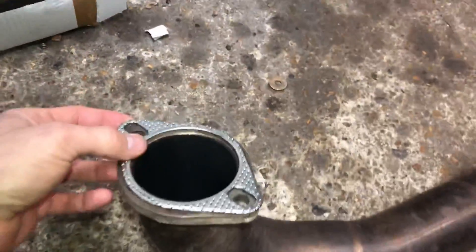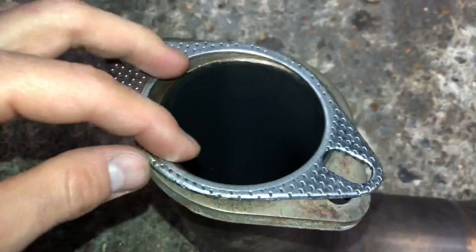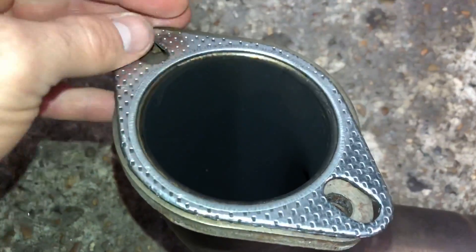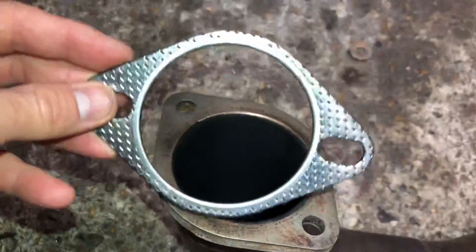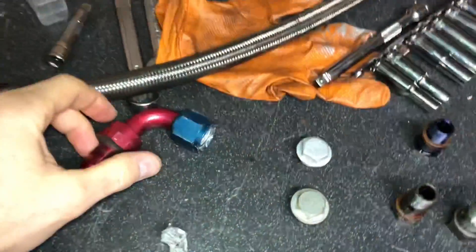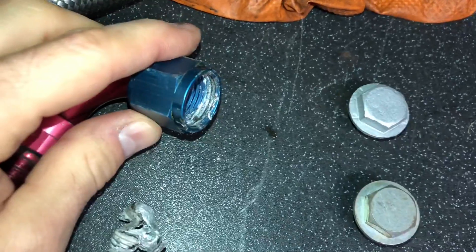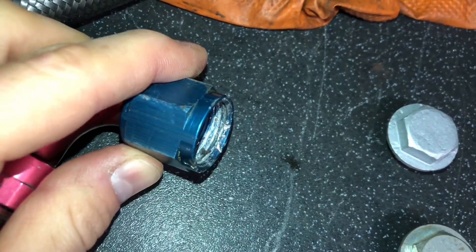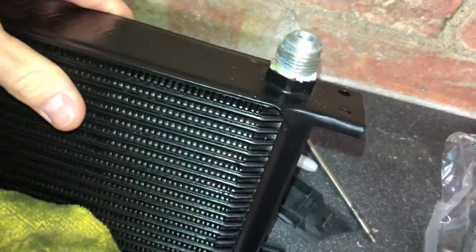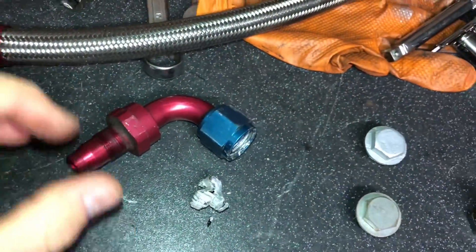Just about to fit the downpipe. As I've mentioned in previous episodes, I like to use fire ring gaskets for these — they fit absolutely perfectly. There's a ring around the inside of the gasket that keeps the exhaust gases in; the cheaper ones don't have that, so make sure you use them. This downpipe didn't have one and was blowing badly. Still having issues with the oil cooler fitting — managed to get the thread out but it's so badly oxidised inside that I can't screw it onto the new oil cooler without damaging the threads.